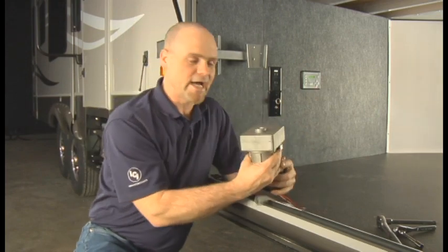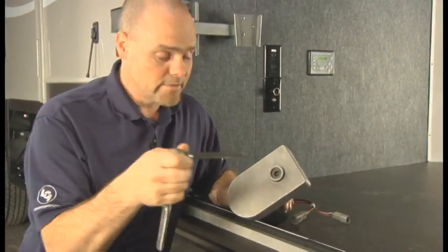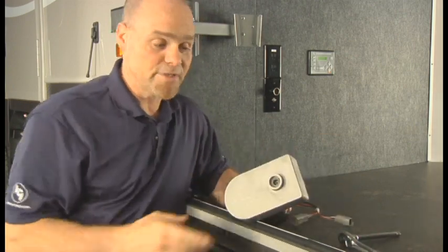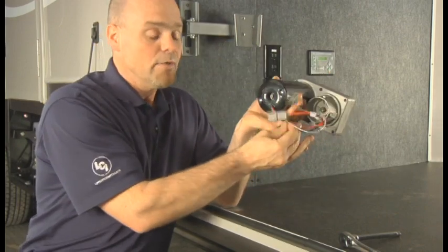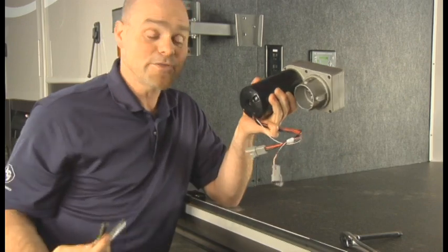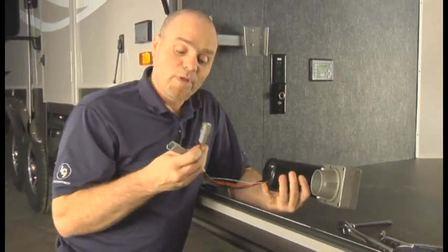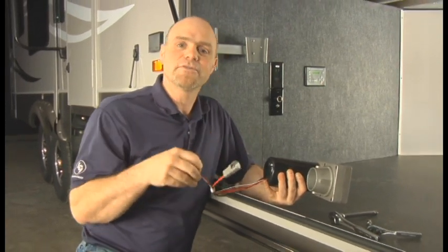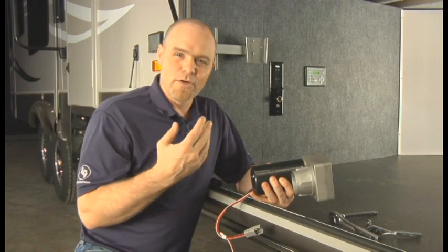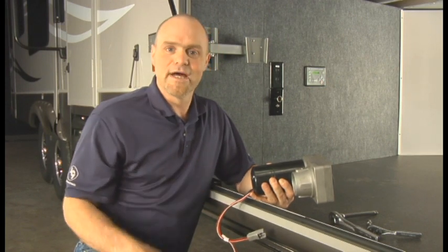Here is the motor mounted on each jack. On top there is a 3/8-inch drive for manual override — insert a 3/8 socket extension to manually crank the jack up or down. For rear jacks tight against the floor, there's also a 5/16-inch fitting on the bottom that works the same way. The motor has two plugs: one for power and ground, and one for Hall Effect sensing. The three Hall sensor wires plug into the control and report how many revolutions the jack has traveled, enabling precise position tracking.